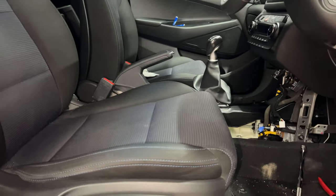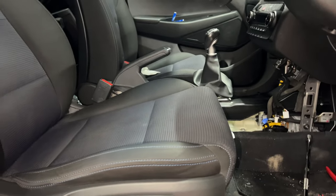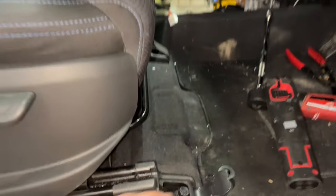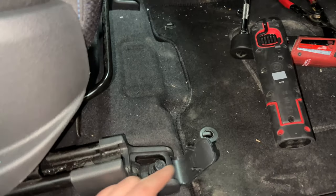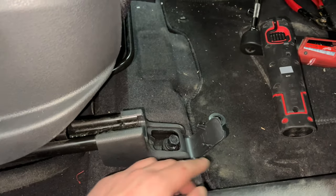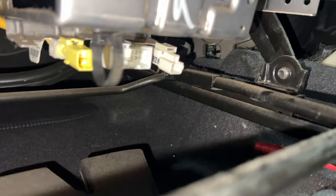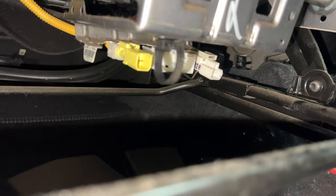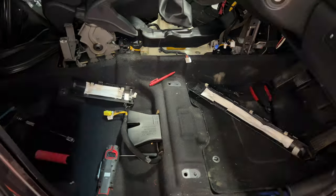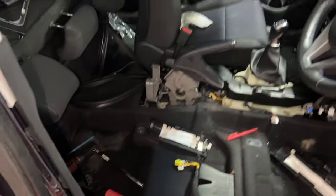So seatbelts on this Hyundai — for the front ones I have to take all the seats out of this car to do both the front and the back. There's a 14mm socket for the seat bolts — lift these covers off and that exposes the bolt. Underneath you've got three plugs: a yellow one and two white ones, a bigger one in the middle and small one to the right. Once you unplug all of them and remove all four bolts, the seat will come out. Now the seat's out, we can start getting to the actual seatbelt mechanism.